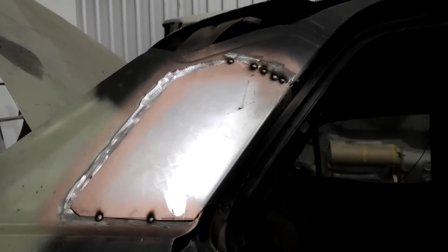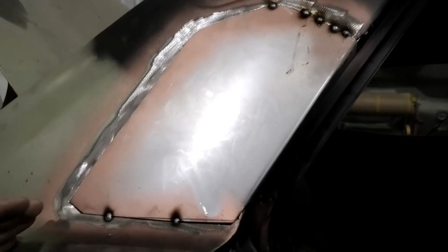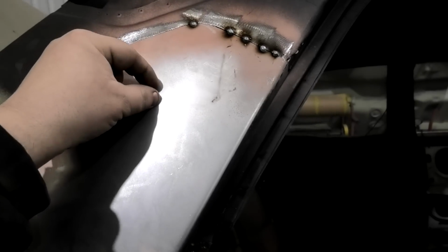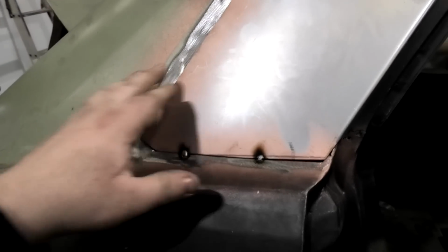Alrighty, fighting quite a bit of rain noise at the moment, but I skipped a few steps. So I've made the piece, cut it, and then cut my piece out even bigger. That sounds crazy, but I wanted to have round edges, and sometimes things don't go as round as I want them. The reason I tend to put round edges in, this is a handy hint for people, is if you have two areas joined together on a corner, the steel tends to bunch up quite a bit more than normal. It gets a high spot right in the corner, because everywhere it welds, it pulls. So say you had a right angle here, your steel is going to go this way and it's going to go this way, and it'll create quite a high spot. But if it's a curve, it is significantly less. But obviously sometimes it's not all doable.